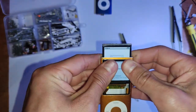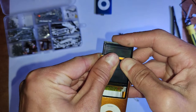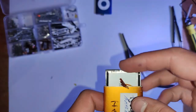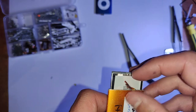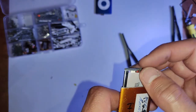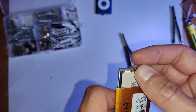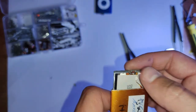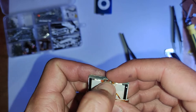And just place it back in, as I'm doing in the video, and push up at the top. It's more like a slide motion, I guess. Again, make sure the connector doesn't come out while you're doing that, because it can pretty often. Now, aligning the lock switch, if it's still intact, hopefully. You have to be really careful with that. It's really easy to snap that along the way.